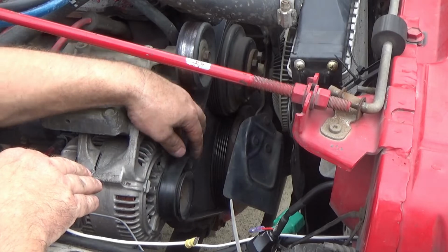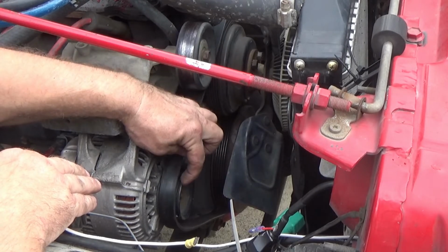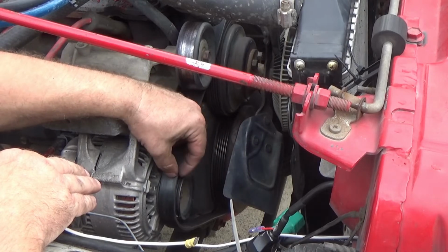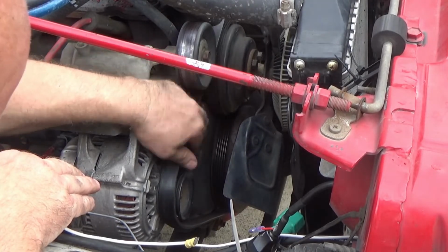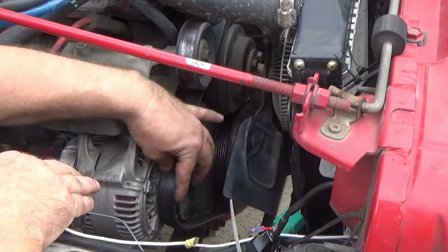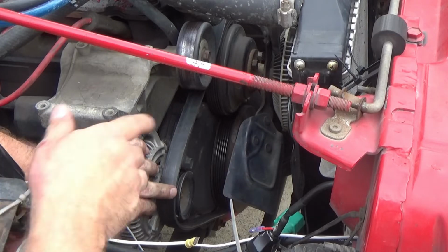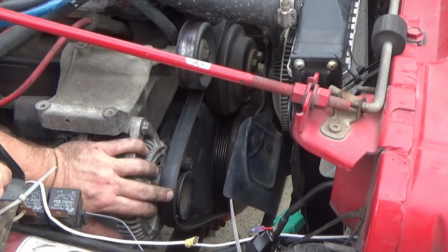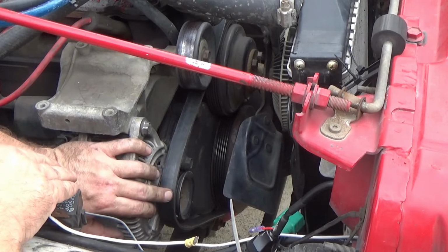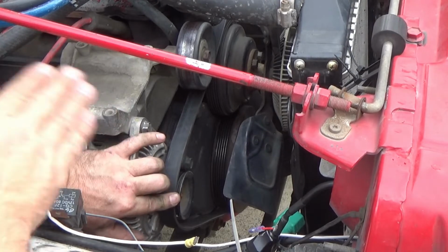This serpentine belt right here is much older than the alternator is, and I've got zero cracks, zero stress of any type on the belt. The belt's in perfect shape. So for anybody that does the Dodge Durango upgrade, and I'll link it up in a pop-up card, or I'll put it down in the description so you guys can check out what it takes to put the Dodge Durango alternator on it, you do not need to change the front pulley. You can if you want to, totally your call.